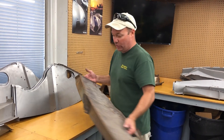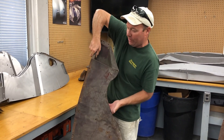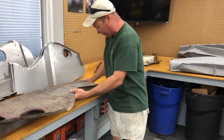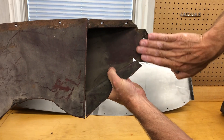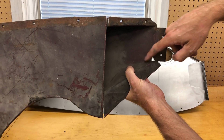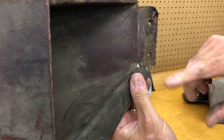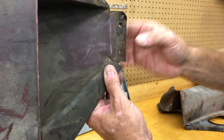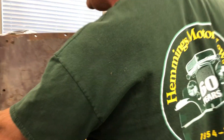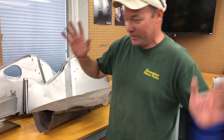Your air cleaner can has two tubes that stick out, and this ducts air right to those two tubes. On the right-hand side I call this a factory flaw — when these are mounted in the bonnet, your right-hand mud shield is bolted here. Every single one of these is cracked in here because it's a flaw. They should have had more welding on here or something, but instead there's nothing there and it just splits and cracks. I have seen one original in my lifetime that wasn't cracked — it was such a big deal I took a picture of it.